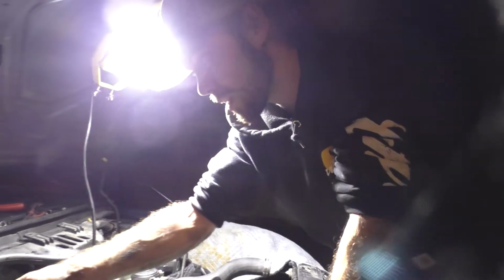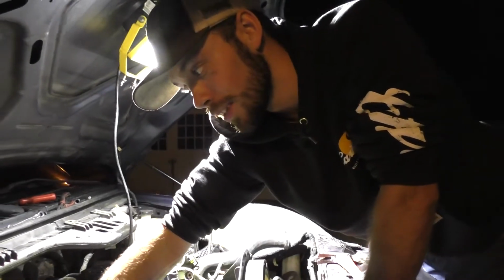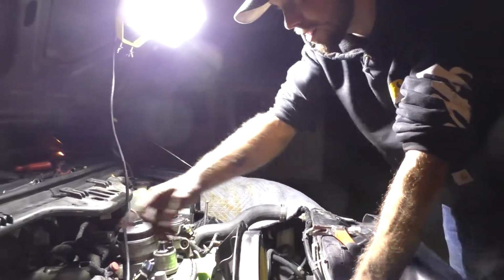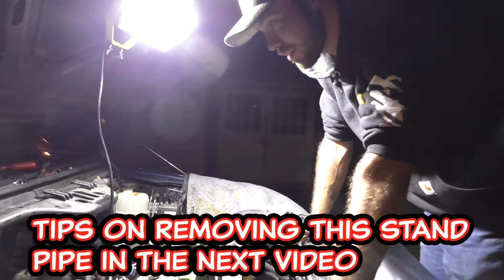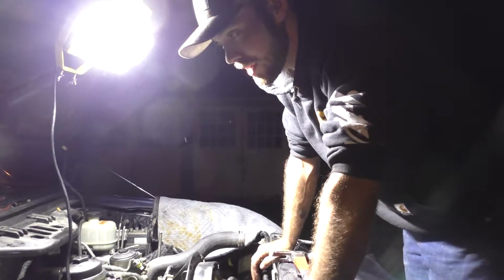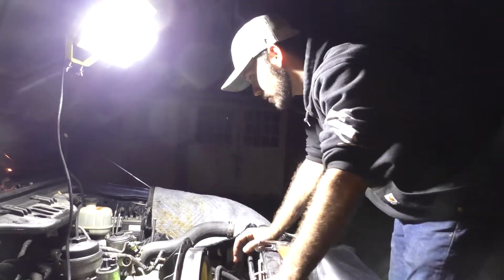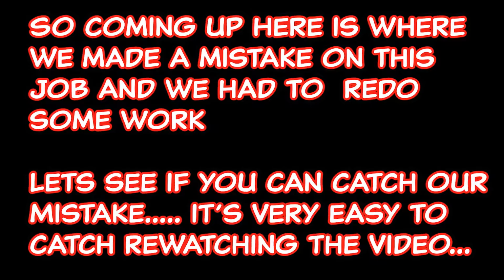But I'm guessing, because that's still a 10, that the standpipe was never replaced, just the dummy plug. So it probably had a leak at the dummy plug, and the new single plug fixed it, and that's all they did. They didn't replace the standpipe, which, to be fair, is a pain on this side. But yeah, in the grand scheme of things, I still just say, because they're not that expensive, just do it all and be done with it, because you'll wind up doing it all over again. Awesome. 2 days later.